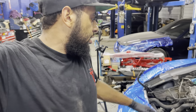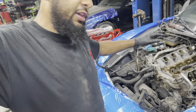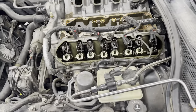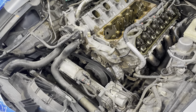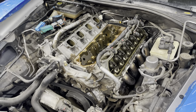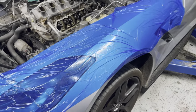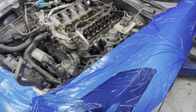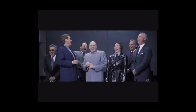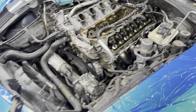We got the valve covers off, got pretty much the top end — the injectors, the pump and all that — out. We're going to go ahead and get the rocker arms off, get the headers out, spark plugs out, the water pump off, all that stuff out of the way, and start pulling the head bolts out. We're getting there, but we do have to get it up in the air and drain the coolant and oil out as much as we can to try to prevent a mess. I got to disconnect the headers down below from the full exhaust and then pull the headers down once I get the spark plugs and stuff out.